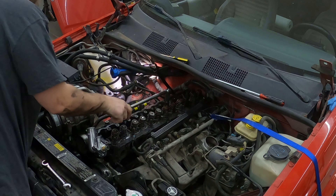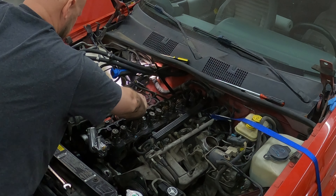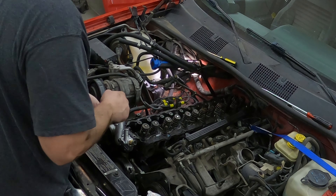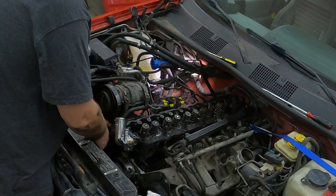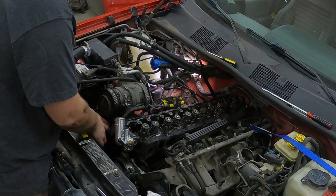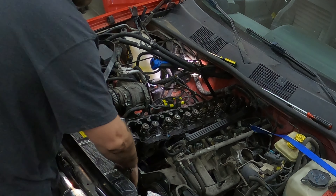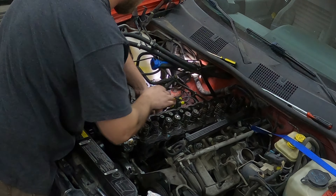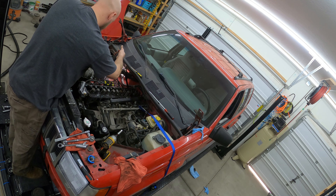Something to note for the head bolts: on the inside of the valve cover I had all bolts, but the new kit I ordered came with two studs for the inside of the valve cover. I just made up where I wanted to put them — I couldn't figure out where they're supposed to go, but they don't seem to affect anything differently. This pulley I removed is right in front of your AC compressor. There's a bracket that the compressor mounts on and that screws into the head, so I had to take those two bolts out. I removed my belt and we replaced it later with a brand new one. You can get a little box wrench in there — a speed wrench would be recommended — and pull the two bolts out holding that bracket to the head.